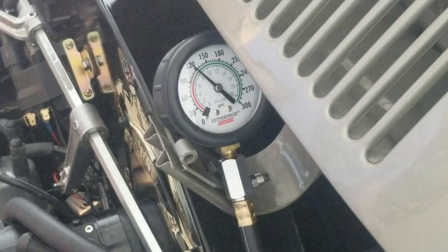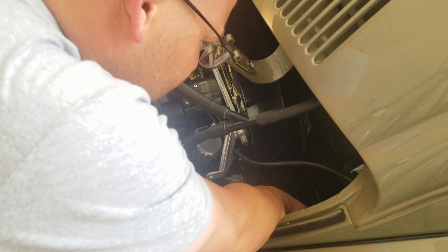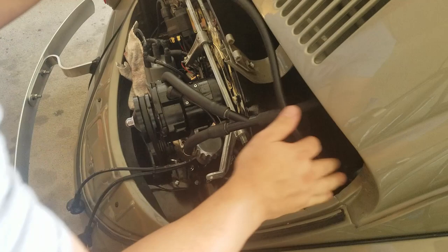Compression is 120, which is definitely good. We've got good compression — 120. That's awesome. This little kit from Harbor Freight was super inexpensive and well worth having. So we're looking at this one should be around 120 PSI for compression as well. Like I was telling you, you want them to be similar or pretty close in compression per cylinder.